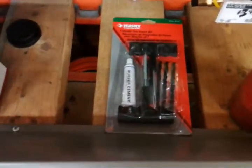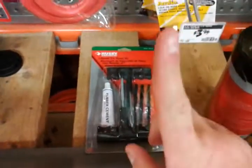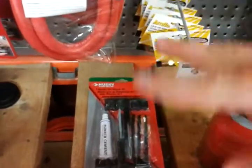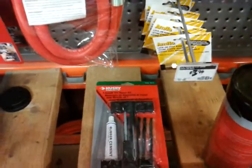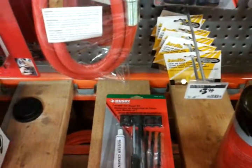Now, the kicker on that one is you have a repair there, but the downside is the part that's sticking out of the tread could potentially get ripped out. So what you do is take a pair of dykes cutters, and you snip off the excess even with the top of the tread, and you basically then drive on. How permanent is that repair? It's not exactly permanent, but it will get you down the road.